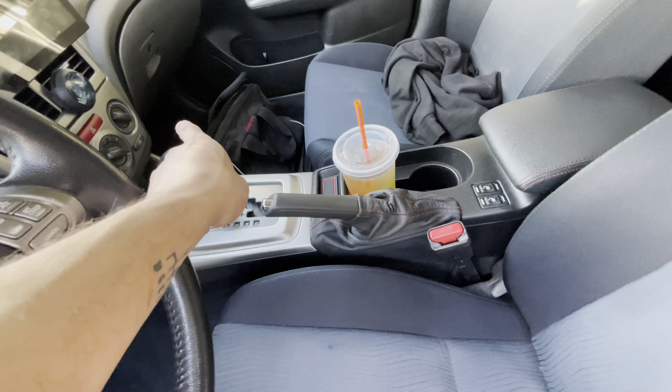Let's start by pulling the seat out. I'll show you guys how to dismantle the seats and not screw it up. I did practice on my original seat just in case. To start, we're going to have four bolts - one down there, another one on the other side, and two more in the back. If you guys do have airbags in your seats - I have the airbag over here - you're going to want to disconnect your battery; you don't want the airbag exploding. The back half of the seat does work but the bottom half does not, so we're definitely going to figure this out.